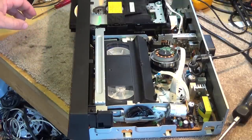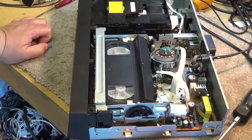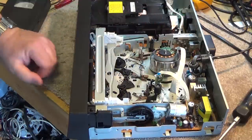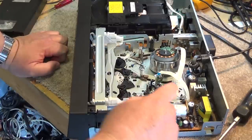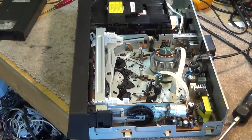I'm going to take that disc out of the drive since we don't need it in here. Let's see if we can eject this tape — it's going to eat the tape. Something is running, a motor in here somewhere. I think before we go any further I'm going to pull the chassis out and look to see if there's a mode switch that may be dirty, because from the way this is behaving, that's what I'm suspecting.